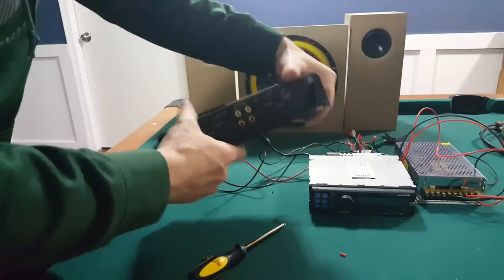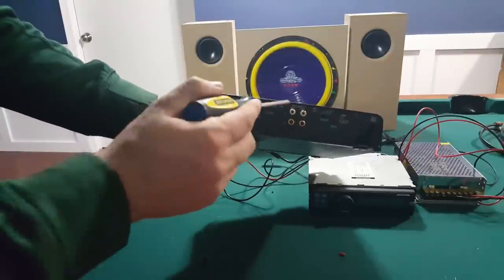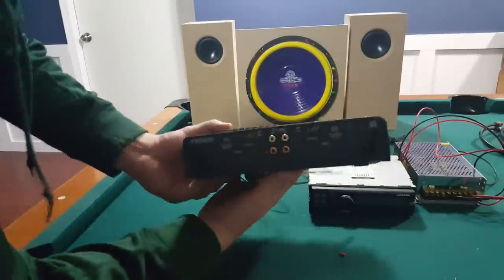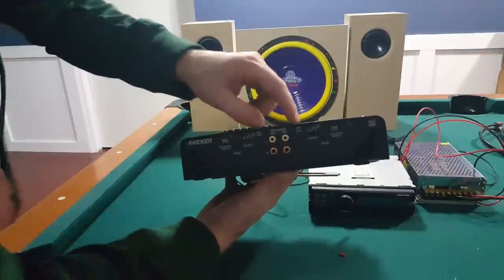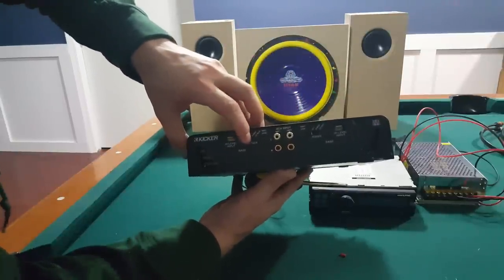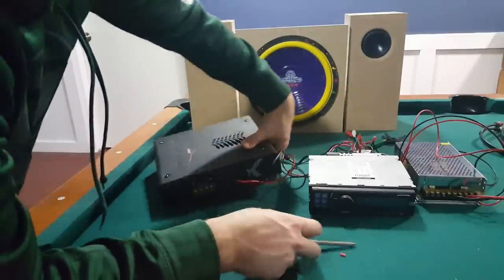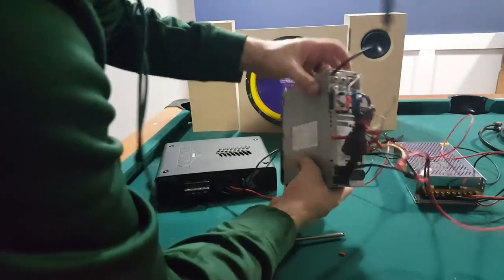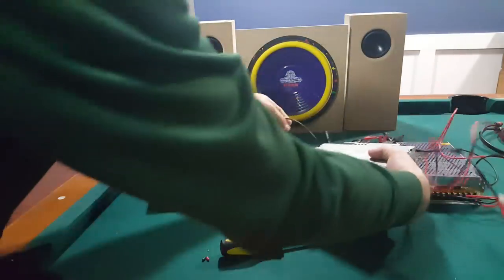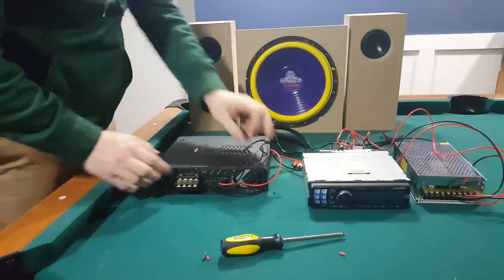On the amplifier — this is a four-channel — you'll notice it has two different inputs: one for amp one and one for amp two. You can assign whichever you want for each speaker group. For amp two I usually use the subwoofer, and I've moved it to low pass; amp one is set to full range which turns the crossover off. I'm going to run two RCAs from the SW output for the subwoofer, and also run the pair for the fronts.